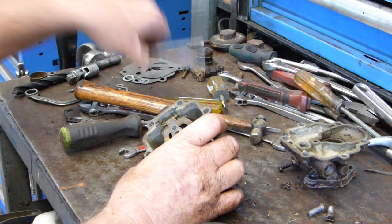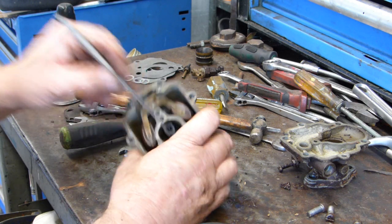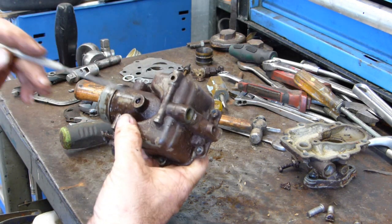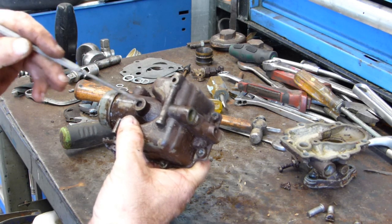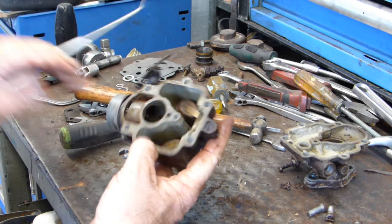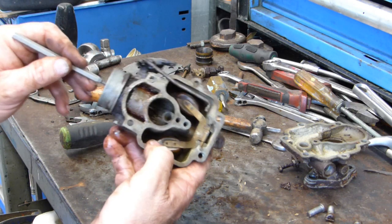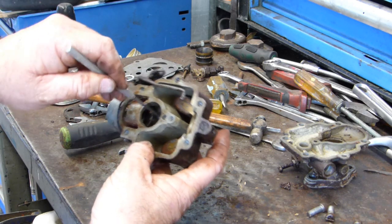That's all okay in there. I'll just make sure there's no rubbish inside. You can see down through the center here. That's the other side of this stone gauze. And the stone gauze is to let a bit of fuel out without letting dirt in if you get a bit of a gutful. But it's all blocked up down there. You can see the rubbish in there, incredible.